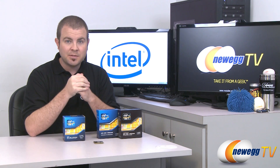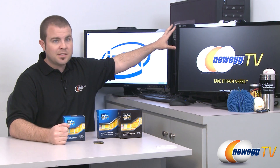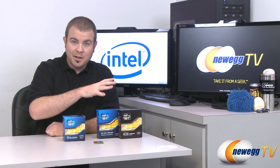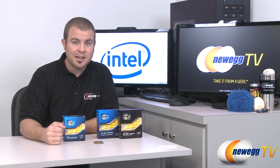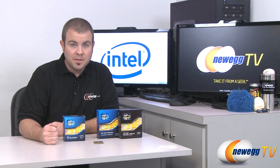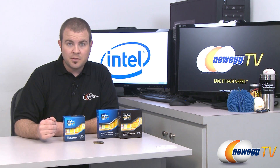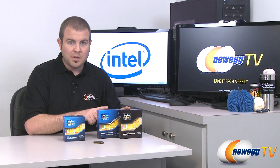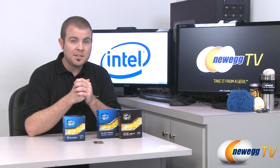Intel's Core i3, i5, and i7 brand actually started with Core i7 and the launch of the 1366 platform back in late 2008. We have a 1366 system set up right here. That was the enthusiast level platform, and it hung around for a while. Then they introduced the mainstream version — Core i3, i5, and i7 — into the 1156 socket with Clarkdale and Lynnfield CPUs in early 2010. In 2011, they launched Sandy Bridge into the 1155 socket, a mainstream platform that will soon be updated with Ivy Bridge CPUs, also fitting the 1155 socket, in early 2012.